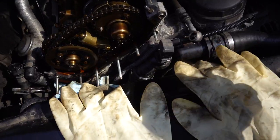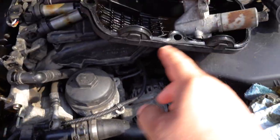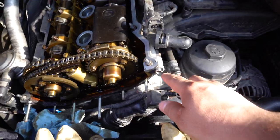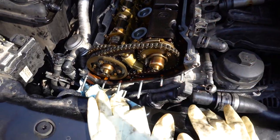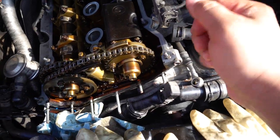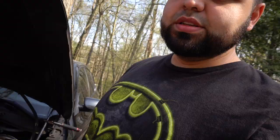This is a very dirty job. My advice to you guys: if you're going to do this job, make sure you have lots and lots of rags and brake cleaner because there's going to be oil everywhere. We got it off. One thing I forgot to mention — you have to take the oil feed line off from the side over here, it's a 19mm and you'll need a wrench. Also take the stud out, that one's a 13mm. When taking it off it gets kind of stuck on the dowels — just gently pry it with a trim tool and it comes apart. We'll throw it in the parts washer to get it cleaned up.